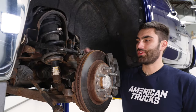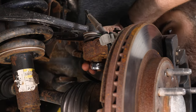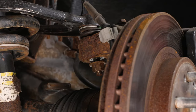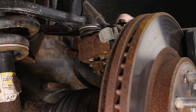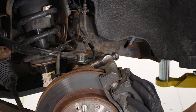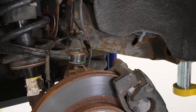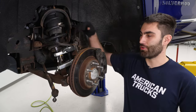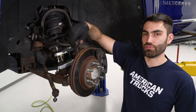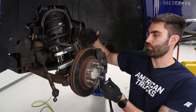Next, we can come to our upper control arm ball joint. We have an 18-millimeter nut that we can take an 18-millimeter ratcheting wrench to remove. We're going to leave that nut a couple threads on, and then we can bang the knuckle with a hammer to break our ball joint free. I'm just going to turn the knuckle to the side to get a better angle and smack the knuckle to pop that free. Since our foolproof method of hitting it with a hammer didn't work, we're on to the ball joint remover tool. We have the top sitting on the top of the knuckle, the bottom is on the stud, and it'll tighten and pop that free. I've got a 19-millimeter wrench to tighten down this bolt and pop our ball joint out.